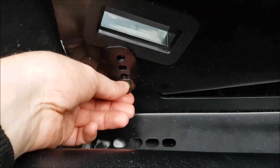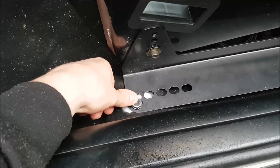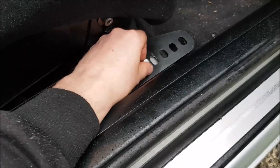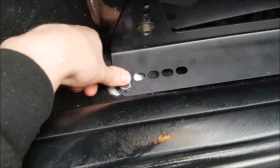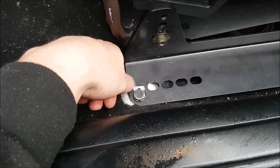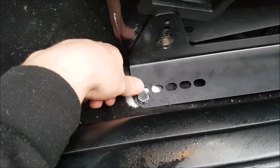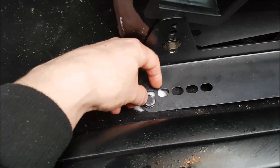The seat came with allen key bolts and washers. For some reason the two rear bolts wouldn't bolt back in — they just kept trying to cross-thread. The two front ones have threads that stick out of the chassis and you just put a nut on, but the rear bolts wouldn't go back in. So I used the 10mm tap, wound it in gently with loads of grease, going in and out a little bit more at a time to fix the thread, and luckily it worked. It's fairly common — quite a few people have had issues with the rear bolts; it's the thread inside the hole.